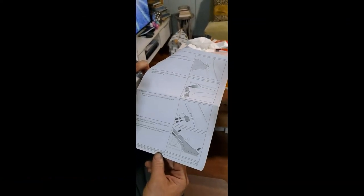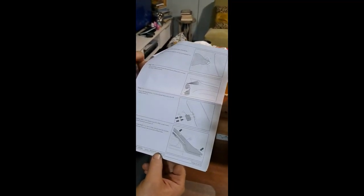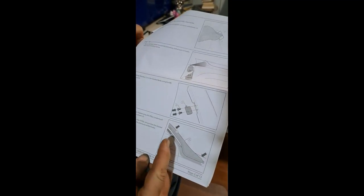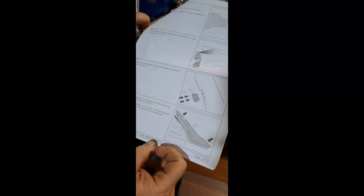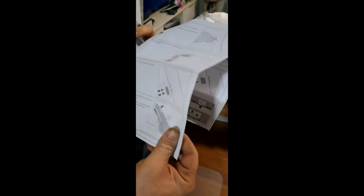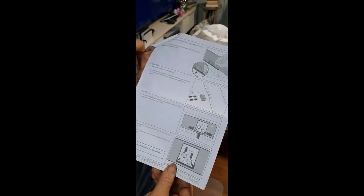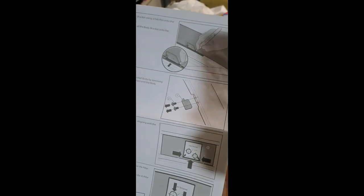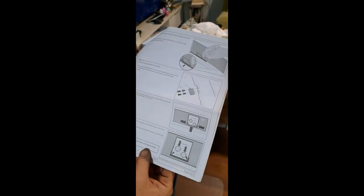Okay people, we're dodgy video artists. We have to add a couple more things we missed in the video because we were tired. Basically where you bolt that bracket onto your snorkel, you use that to actually mark it on the vehicle so you know your position for that little bracket on your A-pillar. There's a little template — I don't know if I showed all that. We definitely missed showing how to mark the position of it, and then you use your template to mark that.